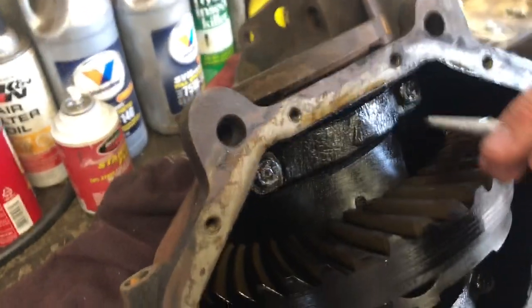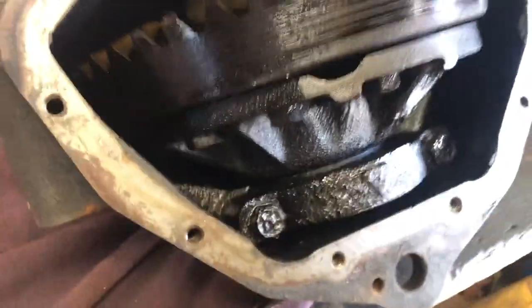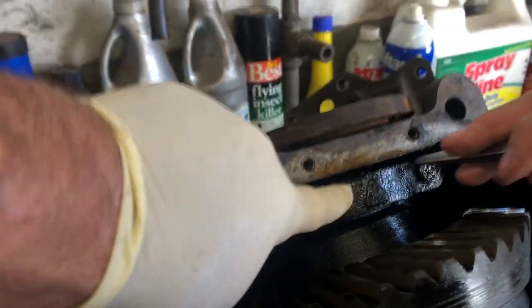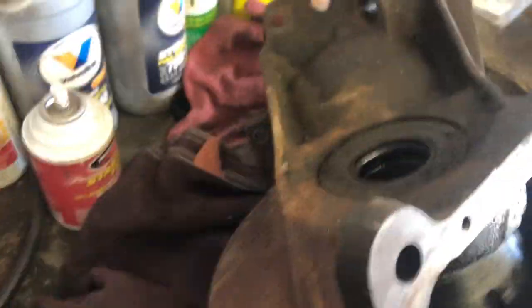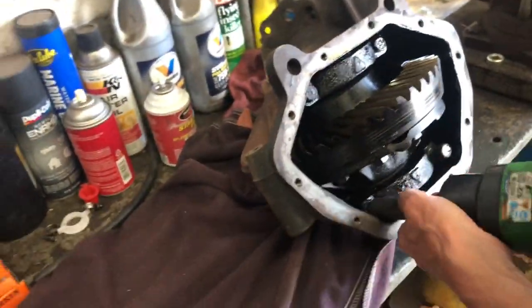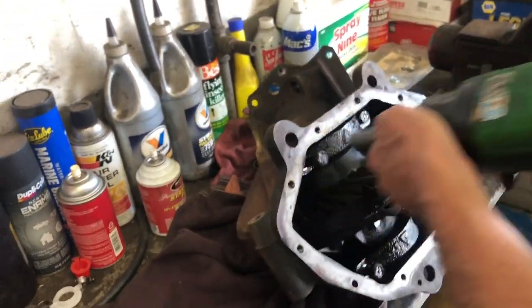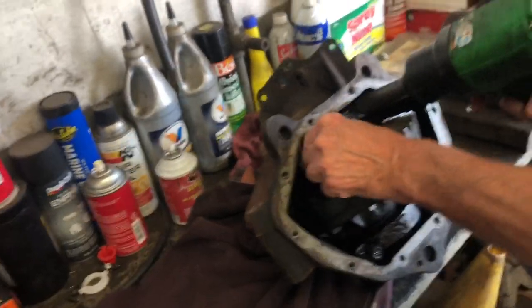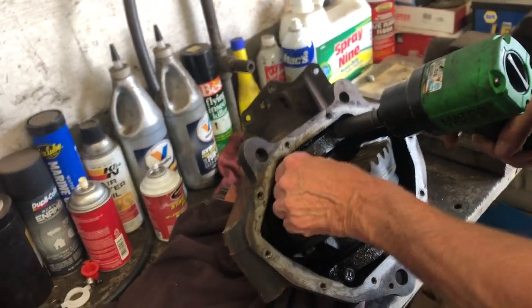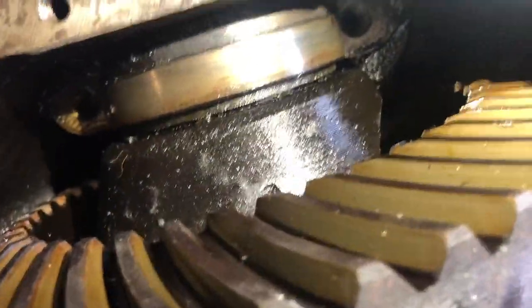On that side, one dot, one dot, and then we put two dots here and two dots here, so we know that these basically are going to come off and go back in the same place — they have to go to the same side you took them off. We took this 9/16ths bolt out, and this just slides right out of there. And then the ring gear runs right into the case.